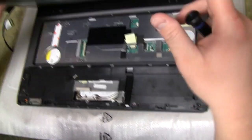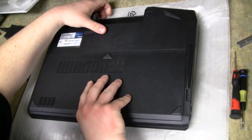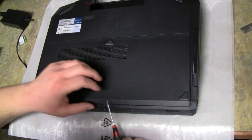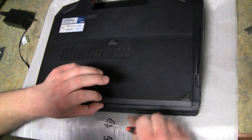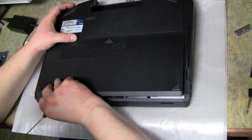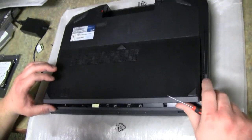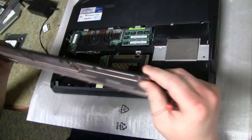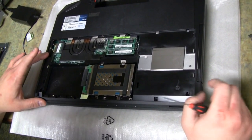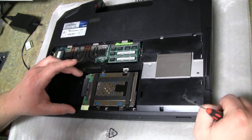Now we can set our screws aside, close the lid, and flip the computer over. You can see it's already kind of lifted up a little bit, so you don't have to use a screwdriver to pop it up if you can get your hand underneath there. This is just going to unclip itself with a slight bit of pressure. If any part does not come up easily, you still have a screw in there somewhere. It should just lift off like that, and now we've got access to the belly of the machine for RAM upgrades, Wi-Fi card upgrades, and where we'll put the secondary hard drive.